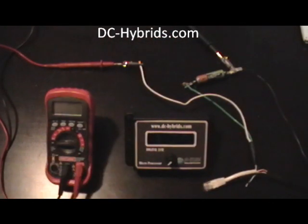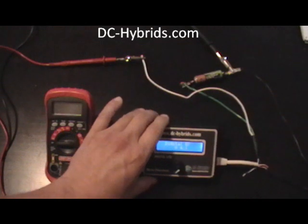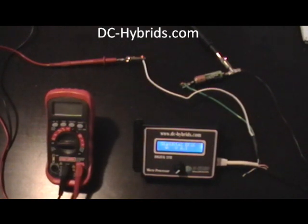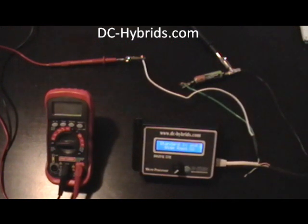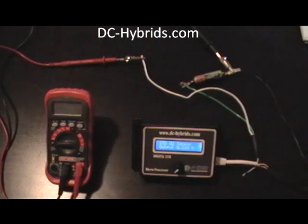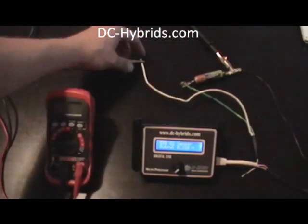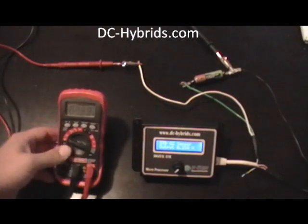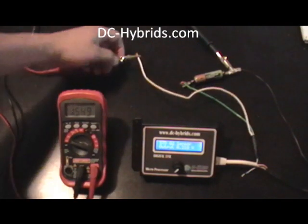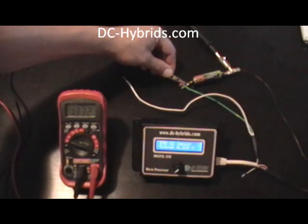For this demonstration I have pre-wired here. Here's our connection — just plug it in. The brown and the orange pair I've got going to a 12 volt source. The green pair, the solid is going to the battery, and the white is going to simulate the ECU. We're going to see our output voltage on the voltmeter here. This would be our standard voltage from the sensor — it's 1.332.